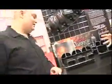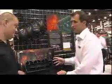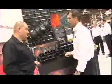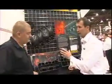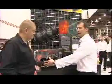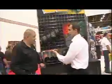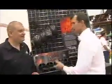Well, that's right. As you get the air in from the throttle body, we cover both 90mm, which is what the aftermarket guys do, and we supply the throttle for that. Or if the guy's got his factory 75, we've got an adapter plate for that as part of the kit. Gets in, there's nothing in the way. Wow. It's a great big open plenum, and it gets that air sucked right in. So right from the get-go, we're getting every bit of air possible into that engine.